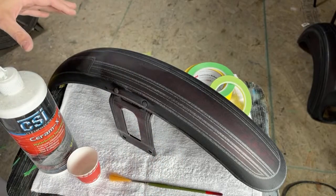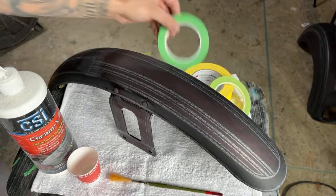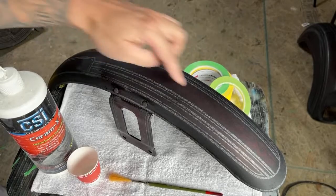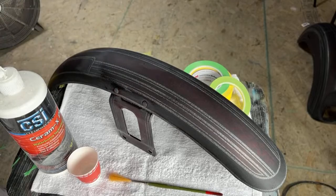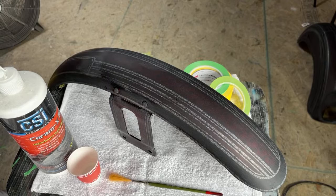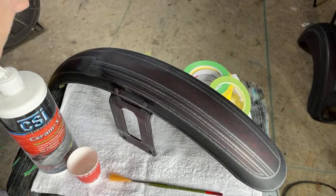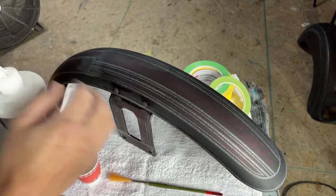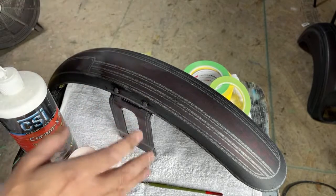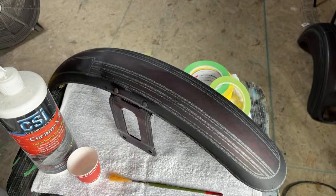to this design right here, 1/8 inch and 16th inch, and I edged it with a candy purple. After I edged it with a candy purple, I put some of the designs with the purple as well. And leaving the tape on, I took it down to the booth, and I applied about 3 coats of Tamco OG red on the top of everything, and then I pulled the tape, leaving the silver. So all the red is a transparent candy color. After that, I cleared it again.